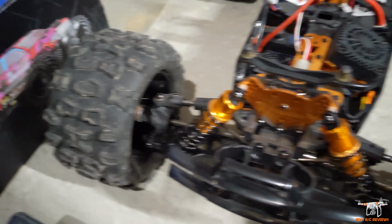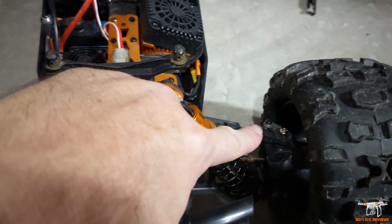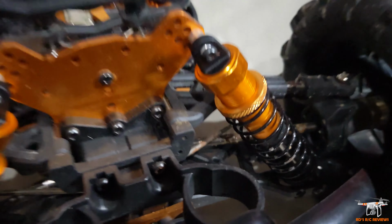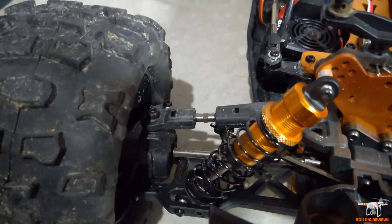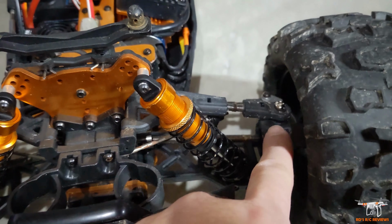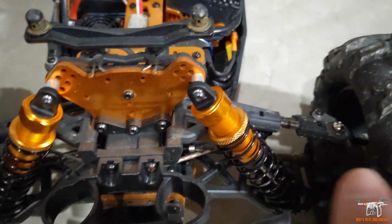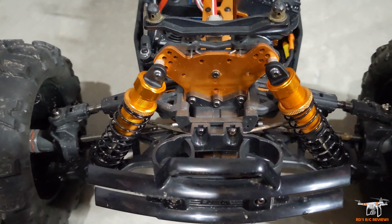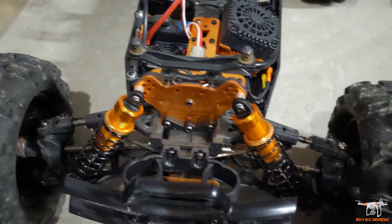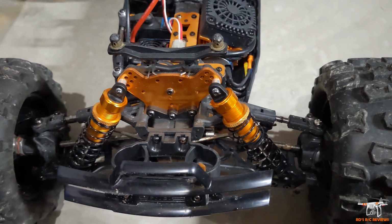All right, guys, just real quick here. Just doing this with my cell phone. Got it all fixed again. I only found one screw that was the right width to go down here, and it was a little bit shorter, but I did add, and I apologize for the poor lighting here, I actually swapped them. The original screw was over here, and I found one of my Phillips head ones that goes in there, and I added some blue thread lock to both of these, so hopefully that'll resolve that problem. That's just weird, I had two screws fall off while driving the Maximus, and I've never had a problem in the past. I just wonder if it's sort of my fault from letting this thing sit so long without driving it. All right, that's all I wanted to say, guys.